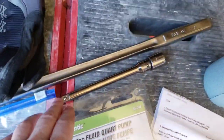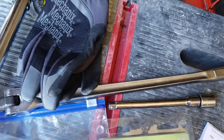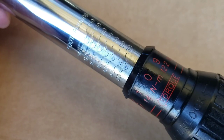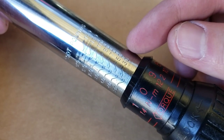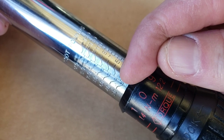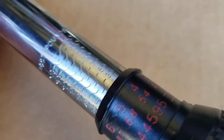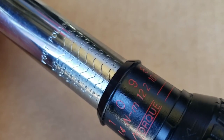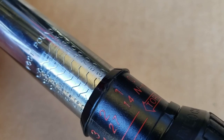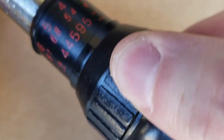We got a breaker bar — from the factory these can be a little tight. A six-inch extension is a perfect fit for this job. Torque spec for this is 35 foot-pounds. To set the torque wrench, you can see the 30 on here — the hash mark beside the 30 is where it resides. To set 35, run it up to 30, match the line with the zero, then go one, two, three, four, five and twist the lock.